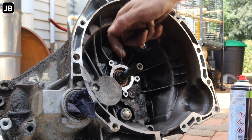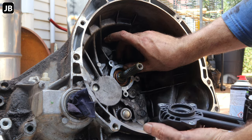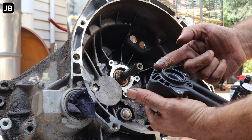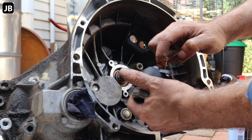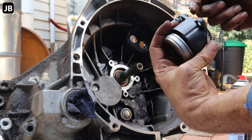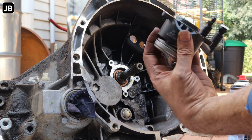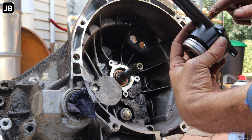By the way, this is in the service manual as well. And then you'll see there's a little rubber lip seal there that rides on the edge here. So what I tend to do is I just want to give it a little bit. You don't want to damage a seal while putting something new back into its place. That'll just make sure that you ride on that seal.